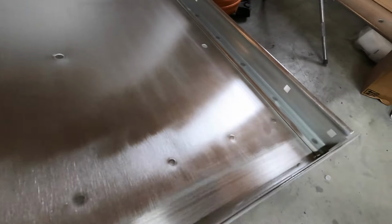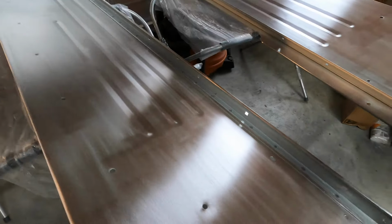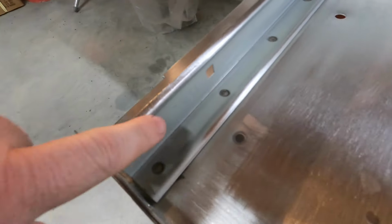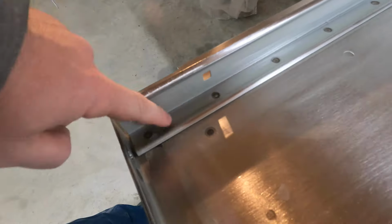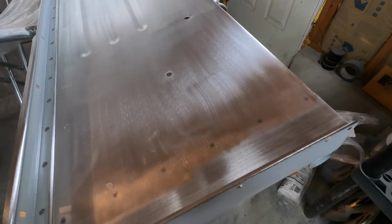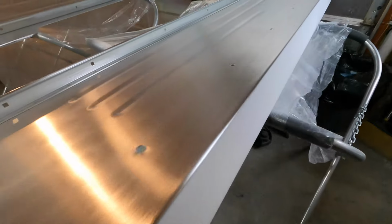I still got a little bit of work to do on these rails for the strip on the bedside for the wood, but other than that, these are ready to go for the primer on this side. Same thing over here. I got the prep work to do on this raw surface, but everything else has been scuffed down, has some good tooth to it. But yeah, you can just see it's so nice and smooth on the white there for the primer.